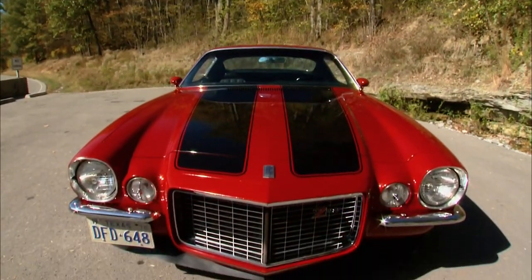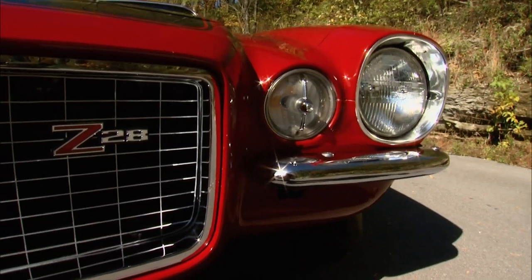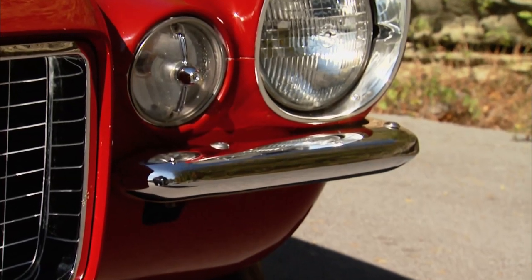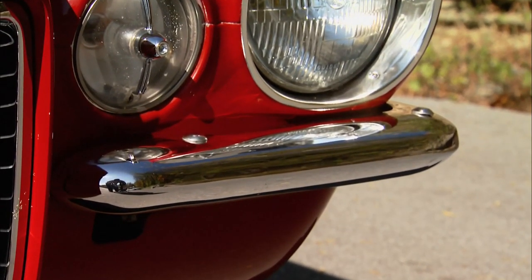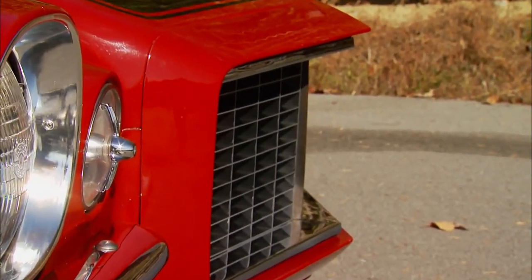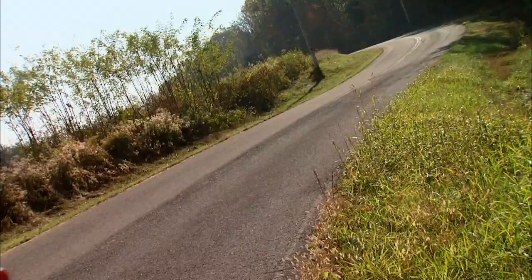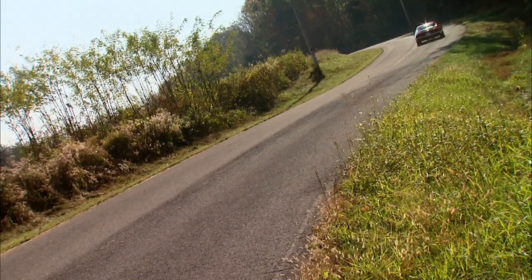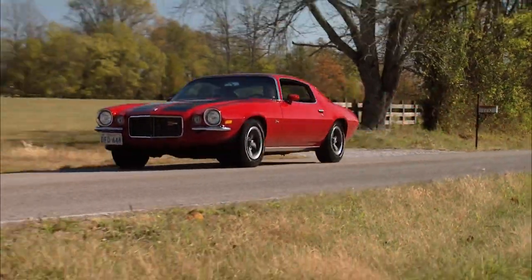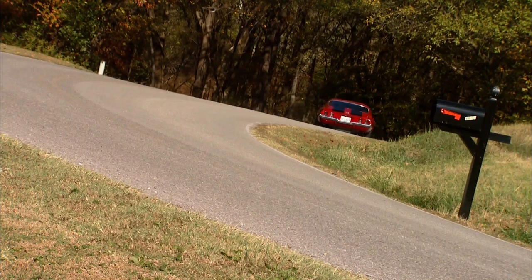Most noticeable was the front end, with the wide mouth grille and headlights molded into fenders. A lot of people refer to second gens as split bumpers, but only rally sports came this way. The package included the bumperettes, turn signals mounted next to the headlights, and an extended nose made of Endura rubber. The new body style also fixed many flaws of the first gen, which was rushed into production to compete against the Mustang. The first gens were noisy and performance handling was somewhat lacking, so GM engineers added a new front subframe to the unibody that provided greater rigidity.